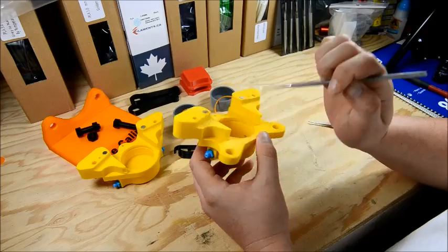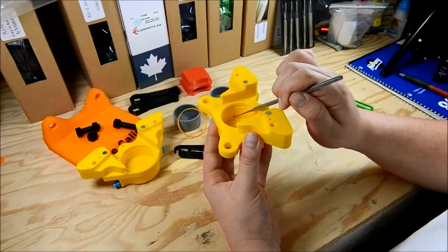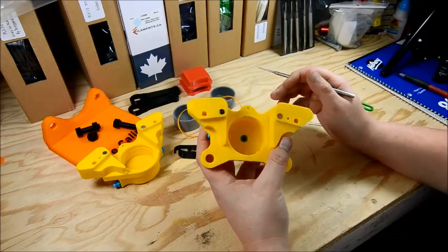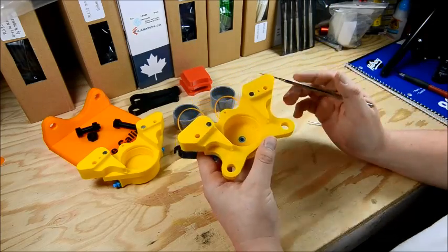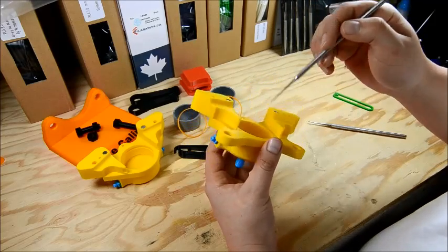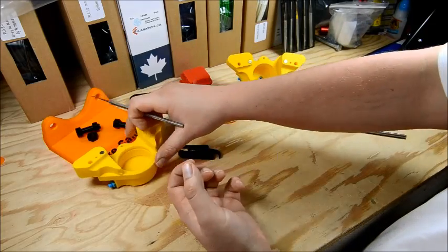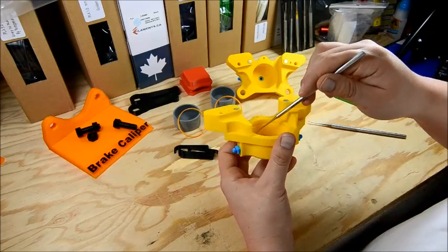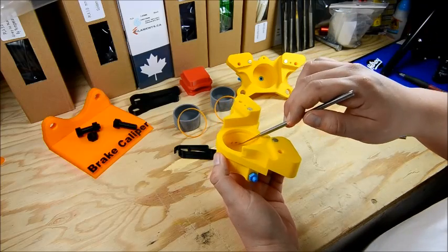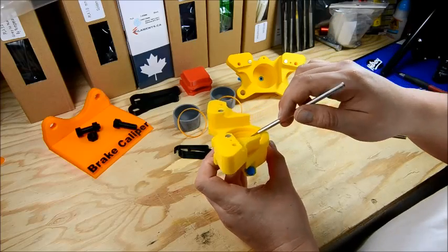With that little crossover port — same down here and on the other side — another bleed screw hole. And that little groove that runs all the way around basically allows the fluid to get in behind the piston and push it, and also get in and out of the caliper body through the bleed screws and the crossover port. Same on this one: piston seal groove and a fluid groove at the bottom, as well as your crossover port hole, bleed screw hole, and bleed screw hole on this side too.